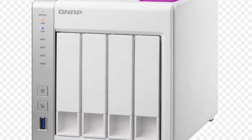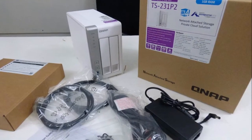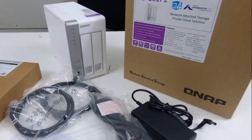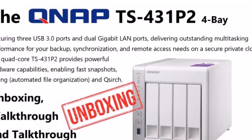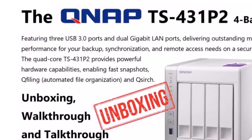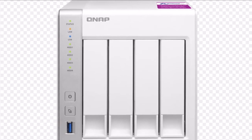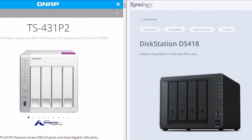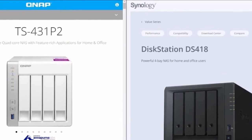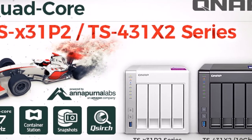This NAS uses a quad-core SoC with enough power to meet the demands of a home or small office environment. When it comes to NAS servers, it isn't only the power of the SoC that matters — its energy consumption matters as well, because such servers are meant to operate around the clock, which means power and low energy consumption have to be carefully balanced. QNAP paired this SoC with 4 GB of RAM, and that total can be upgraded to 8 GB. The only downside is that there is only a single RAM slot, so you will have to replace the 4 GB SODIMM with an 8 GB module.